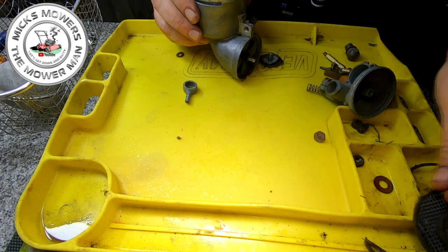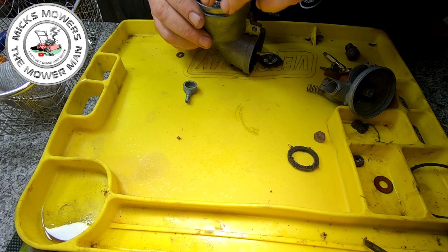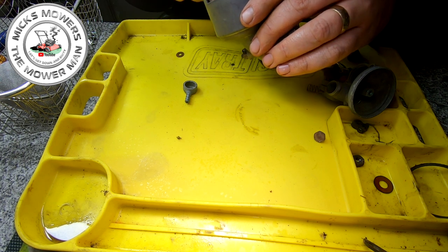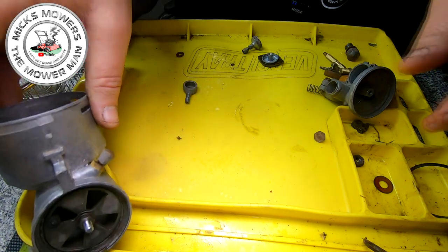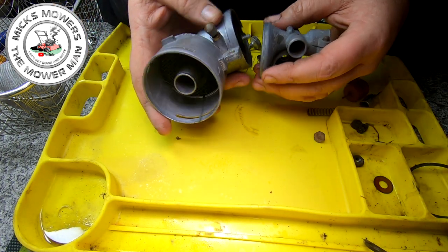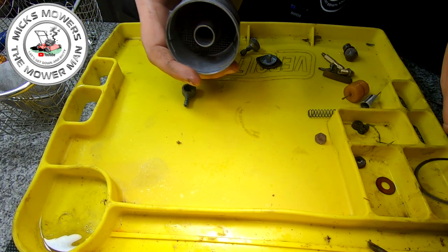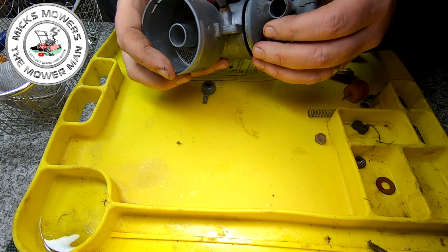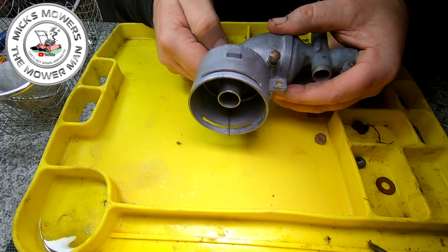To reassemble is very simple. You've got your little tiny oil screen here - a bit of petrol to clean it as described. That goes down on first, sink that in. And a little tiny fibre washer - that goes on top like so. That's got to have some oil put in there which I shall do before I send it out. So that's that bit quite easily sorted.